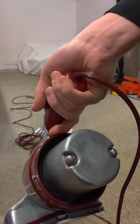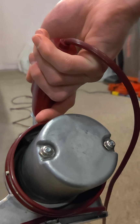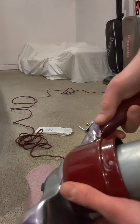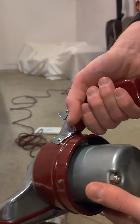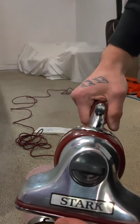It's kind of a pain in the butt with the whole procedure. You literally have to remove the brushes in order to pull the commutator and motor core out in order to access or oil the front bearing, or to even have access to the fan to change that or maintain it, whatever. But bearings are oiled, should last a fair amount of time. I don't plan on using this every single day because it is too beautiful to destroy, but I definitely enjoyed this little thing so far.